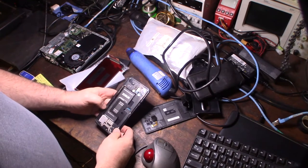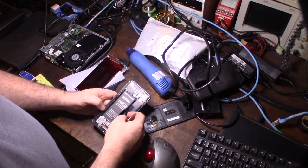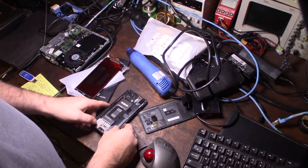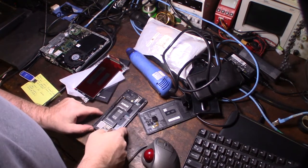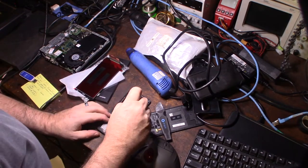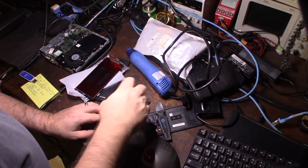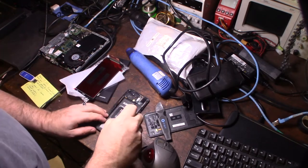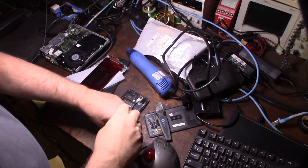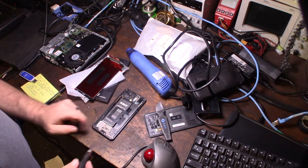Yeah, that's a replacement battery I did on this phone a while back. As far as I can remember, the battery connector was under here, so I have to take the top cover, the top plate off here. So a small Phillips screws around the edge. And that should give me access to the actual ribbon cables. So there's a couple of ribbons. I'm going to undo the battery to remove power. And then there's actually the digitizer cable under here.